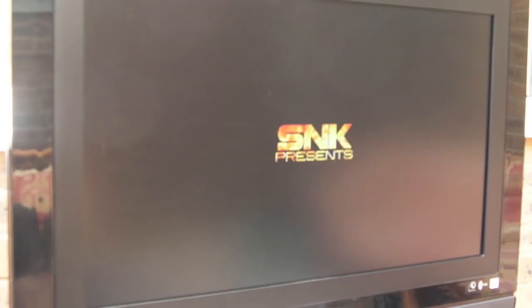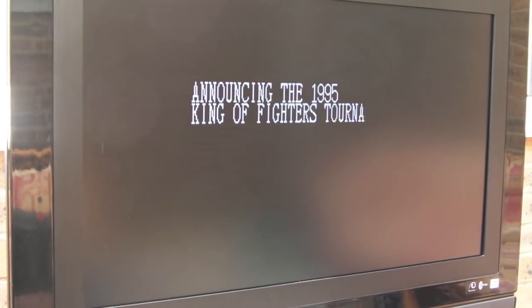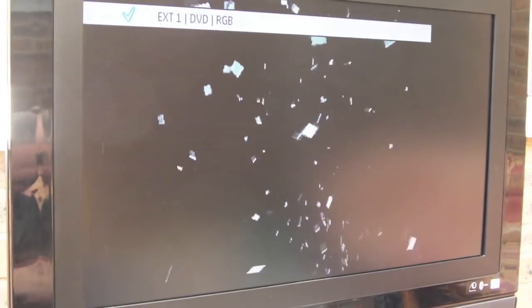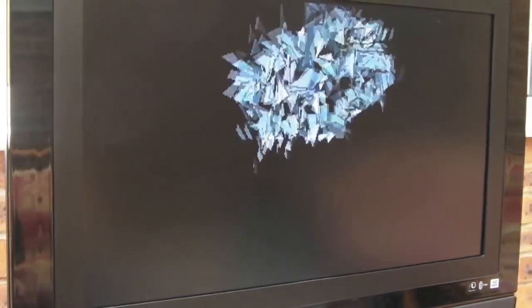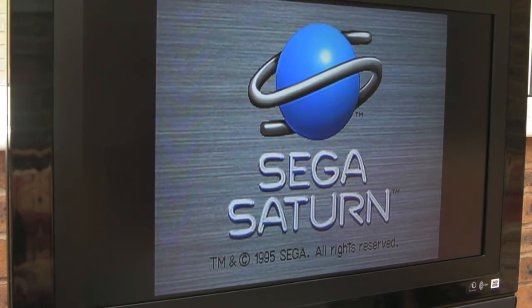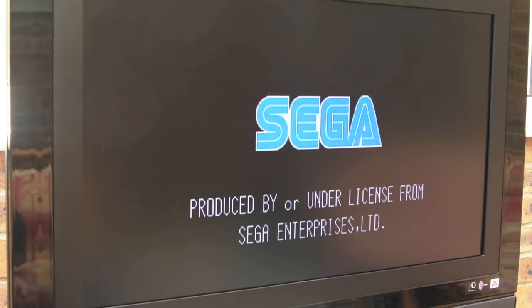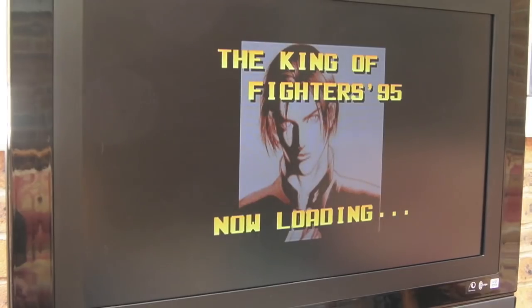Yeah, so I've got these working quite reliably now. That was just after swapping cards, it worked first time. Let's swap back to the other one, and all I've done here is introduce a little bit of IPA before I've stuck the cart in, and then push it in and out twice, and it seems to work every time. So I would suggest, if you've got cart problems with your Saturn, do spend a bit of time cleaning the cart up, but also do what I've done, stick the cart in and out there a number of times.